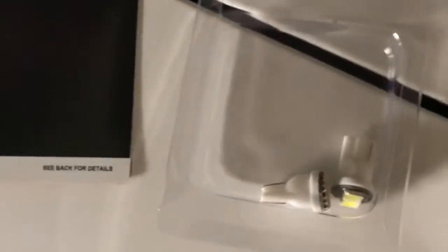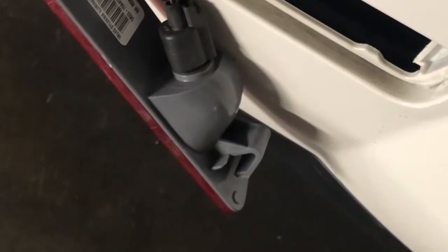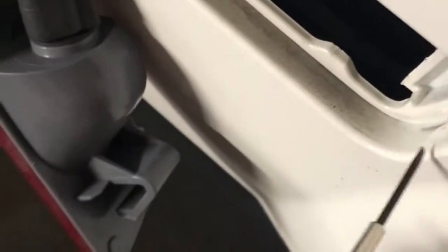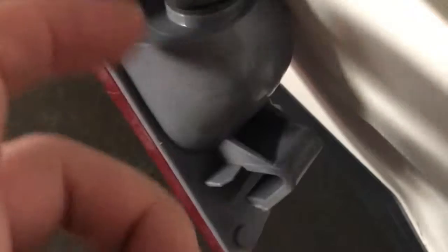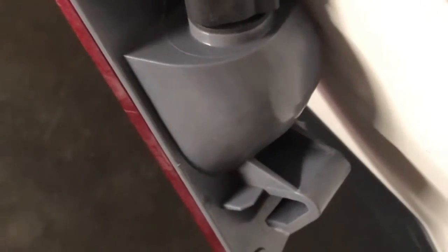And then you're gonna work with your LED license plate. Another clip here today of the Diode Dynamics LED lighting — got the two bulbs right here. So as you've probably already seen, I did the license plate bulb, the trunk bulb, the two map bulbs inside of the cabin, and now I'm doing the side markers on my 2009 GT500. What I did was take a small flathead, get it into the side underneath, and just pop it out. The two retaining clips inside of here will pop out as well. Make sure it turns on before you screw the connector back into the assembly.